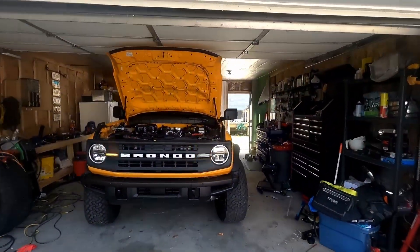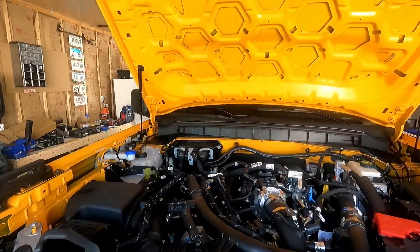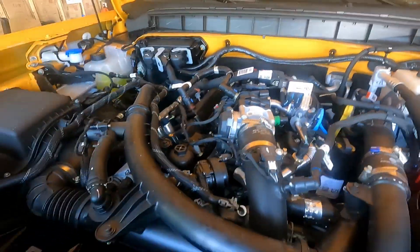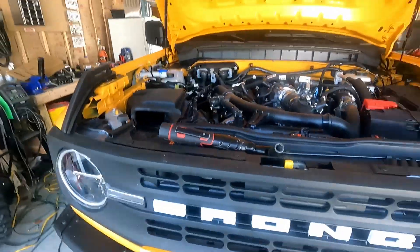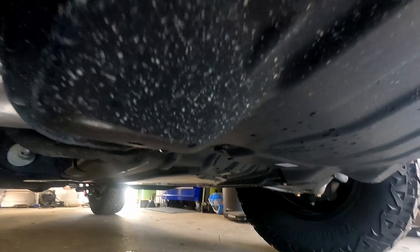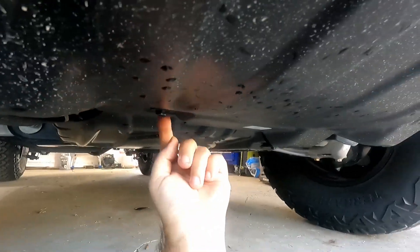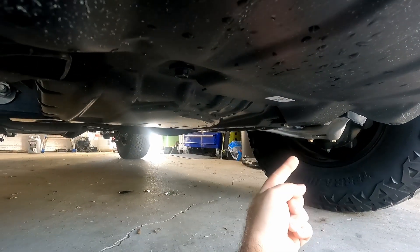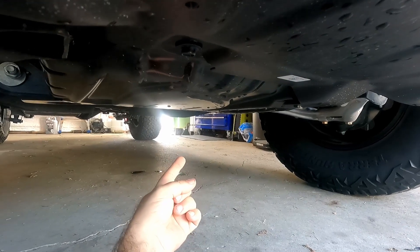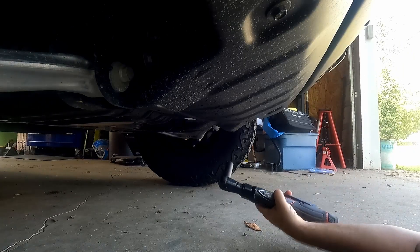Welcome to the channel, my name is Bill. In today's video we're going to do our first oil change on the Bronco. It should be pretty simple - the oil filter's up top, oil fill spout, and underneath to get to the drain plug we have some armor. We don't have to take the front plate off, just the back one. Loosen the two front bolts, remove the back two, and the whole plate comes out. These are just 15 millimeter.